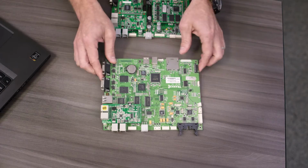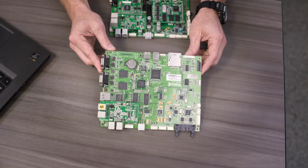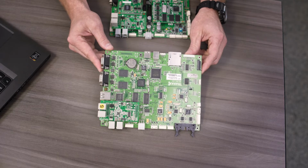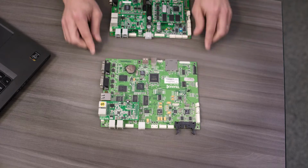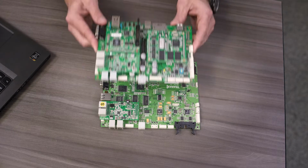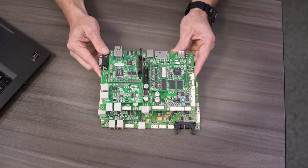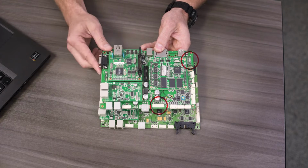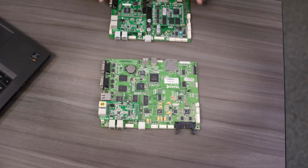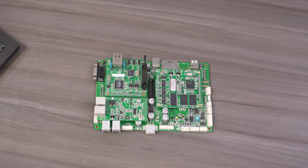For today's tip, we're gonna go over a seemingly daunting task, but it's actually pretty simple, and that is Genmega or Hantle software downloads. The first step would be to determine what kind of mainboard you have. The ACU1 motherboard is only used in the C4000 machines and is characterized by a socket-style video connector in the upper right-hand corner. Hantle then upgraded to an ACU3 or 5 motherboard, which look very similar. It's characterized by a ribbon-style video connector on the bottom of the board or a socket-style video data connector in the top right corner. It also only has one USB port in the top right corner.